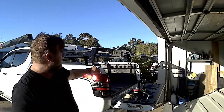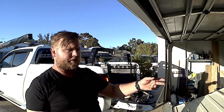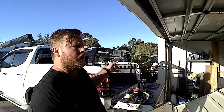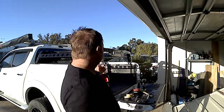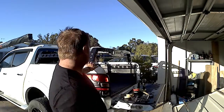You can see how I placed the bolt facing up. In the video I'll include some pictures where I show you how, and you see it in the instructions as well, but in the video I'll show you how much space you have in mine anyway to work with. Yours may be different, but on most tubs, when you get towards the edge, you're running out of room and the metal or the tub liner might come out and cut off some of your access. For me, I couldn't get either a socket wrench or a normal spanner up there, but I could just get the Allen key in there to hold it steady while I tightened it up from the top.